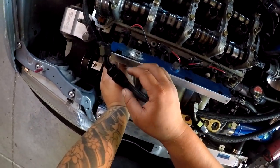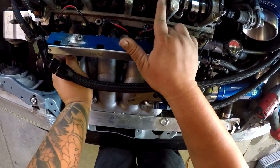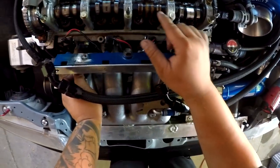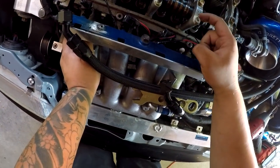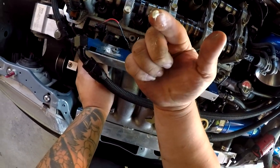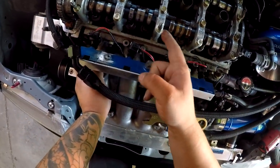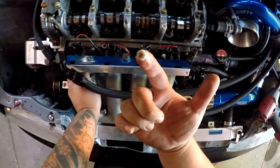So I just took off the valve cover and I noticed the rust on the lobes right here on cylinder 3. You can feel it with your finger. No idea. It might have already been there from when I bought the motor because it sat for a year. But look at the milk. You guys see that? That's all that blow by or blown head gasket, I don't know. But it's only right here on the studs, but it's not in the oil or anything. So that's probably just from the blow by.